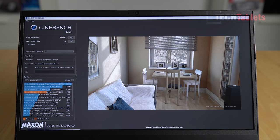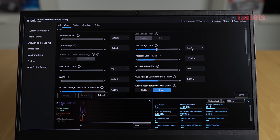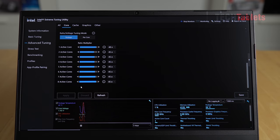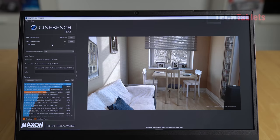I decided to see how far I could push this chipset by overclocking and undervolting with Intel XTU. I got a Cinebench R23 score of over 14,000 points. What I did was undervolt 0.070V on the core and cache, then added an extra three to the CPU multiplier. With Tiger Lake, Intel lets us overclock by up to four multipliers even on H-series chips. I also set higher power limits, changing both PL1 and PL2 from the MSI stock 200W values, which produced that impressive result.